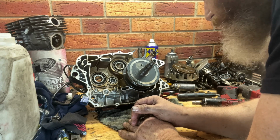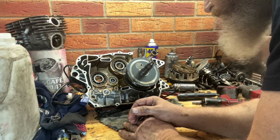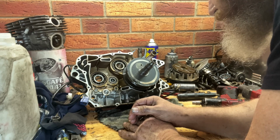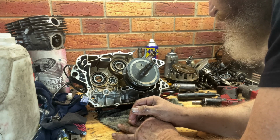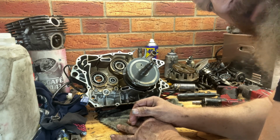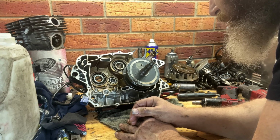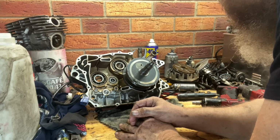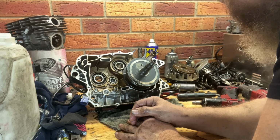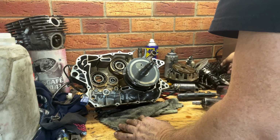We'll check the piston bore clearance. The next video, I'll pull this head apart, and we'll show you how to maybe cut some valve seats, because I do have the cutters for doing these, and set them in. That's alright. I'm going to see if I can find a better sump plug. And I'm going to check up on these friction plates to see if they're supposed to be black.